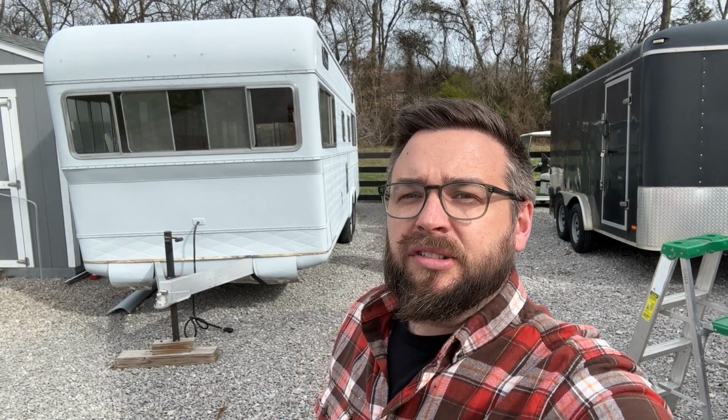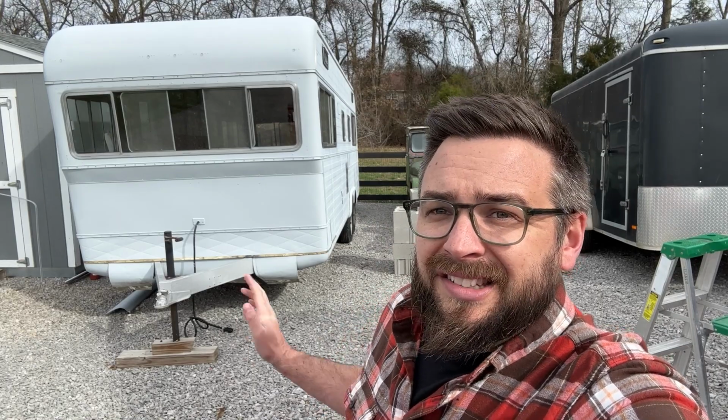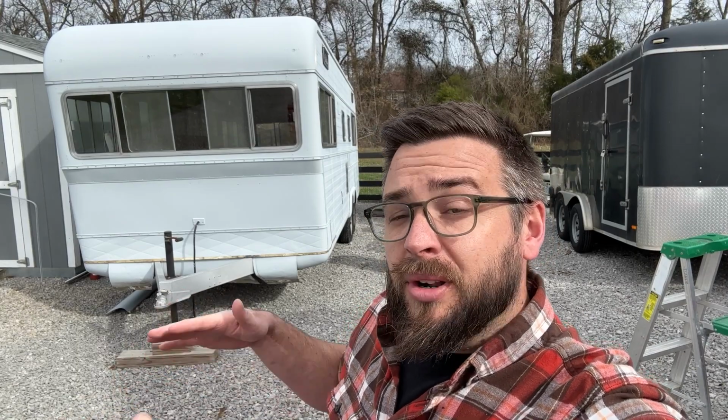The way these are built is there's a metal frame on the bottom, and with a lot of trailers there'd be that, and there would be metal cross supports that go across as floor joists, basically, to use a house framing term. The way it works on this is they have 2x2s or 2x4s on flat that run across that metal frame, and then on top of that is 5/8 plywood, and on top of that sits the walls. And those metal frame rails run inside the wheel well, so they're not the full width, and so those 2x4s hold the part that overhangs.